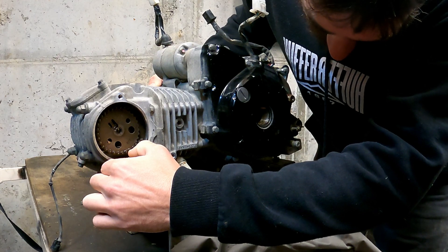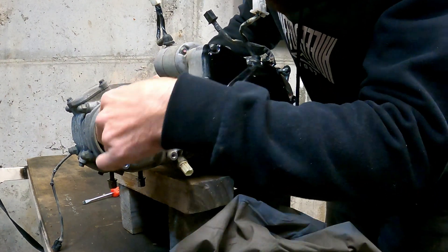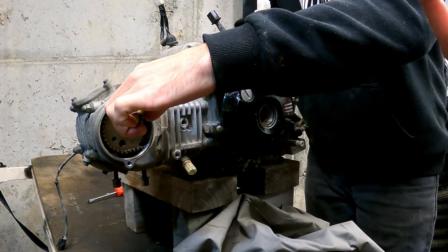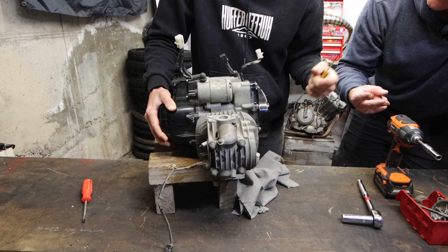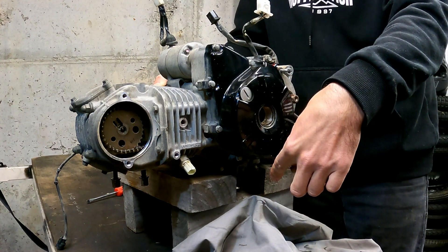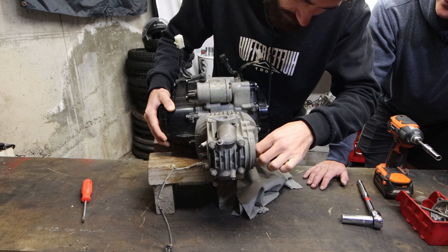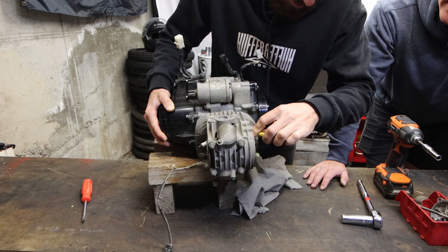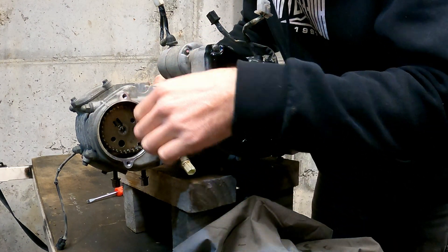That oil looks quite dirty. Now why would the oil in here be so disgusting and dirty when I do regular oil changes? I'm obviously just doing something wrong. That oil pretty much sits under the cam chain tensioner piston, and when you do an oil change that doesn't get flushed. So unless you drain this and fill it with fresh oil, that part doesn't recirculate. So people like me who just think 'I'll change the oil and you'll be all good' can do themselves a mischief later on. These engines are known for basically destroying the rollers on the cam sprocket, and it's probably due to stuff like that.